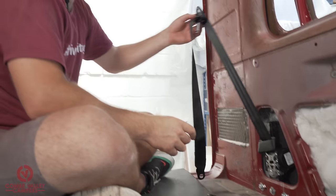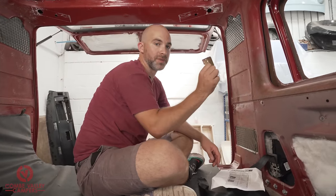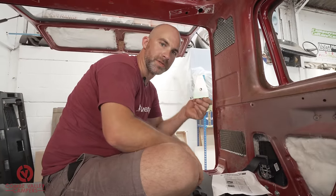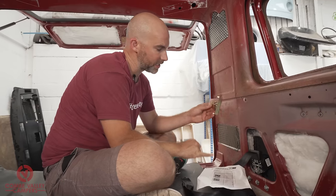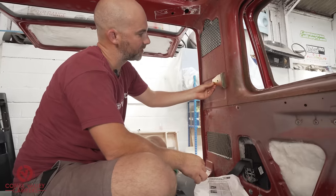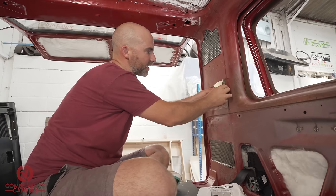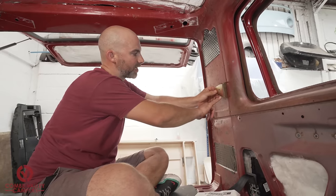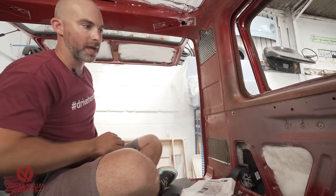So, next move is to put our shoulder bolt in. These brackets, which are the ones that mount up in this D-pillar, they're universal. So they will fit the left-hand side or the right-hand side. And as such, they have one, two, three marker points for you to align. Now you only need two of those holes to align for one side or the other. In this case, this bracket fits inside this pillar down there in that orientation. This panel sits flat against here, and this flat piece sits against this seam of metal here. So in the event of an accident, it's braced this way and that way. All right, so it's not going anywhere. So we're aligning up this hole and this hole to one dimple and two dimples. Let me just go and get a Sharpie and I can show you that a bit easier.